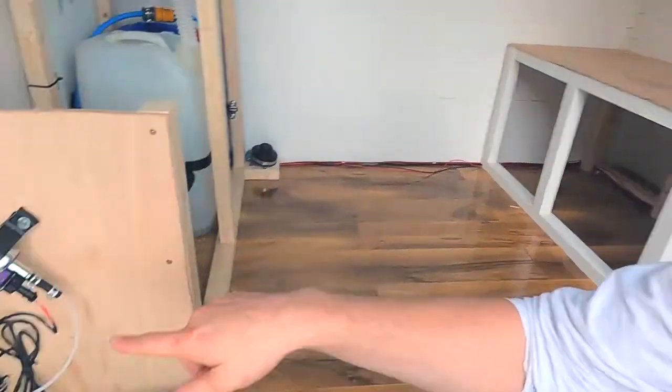It took me a couple of days to realise that the only thing I'd done wrong was using a cable that was too thin. Over that short distance, I had a voltage drop before the heater could get going and it would just cut out. I saw people online trying to fix this — some replacing the control unit or getting a new pump — and I didn't want to throw more money at it. I figured that at least the cable, if it was wrong, wasn't a total waste since it would probably be useful for something else. Got the right cable and it powers up just fine.